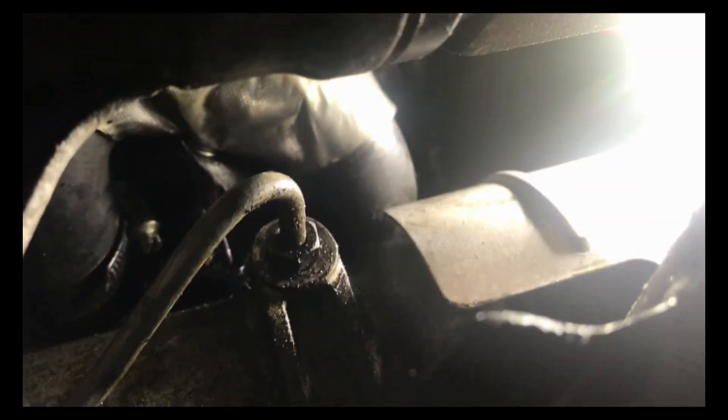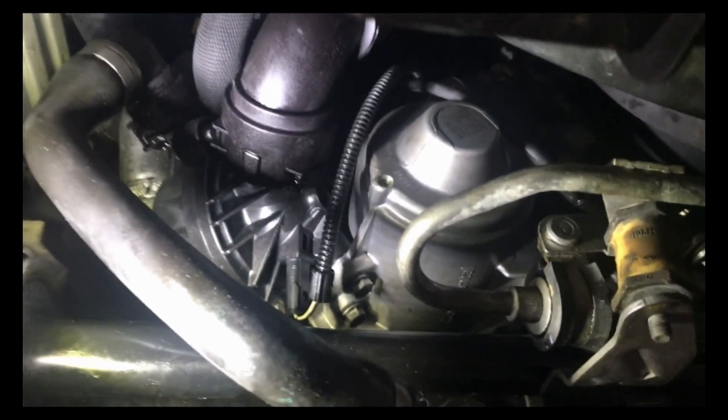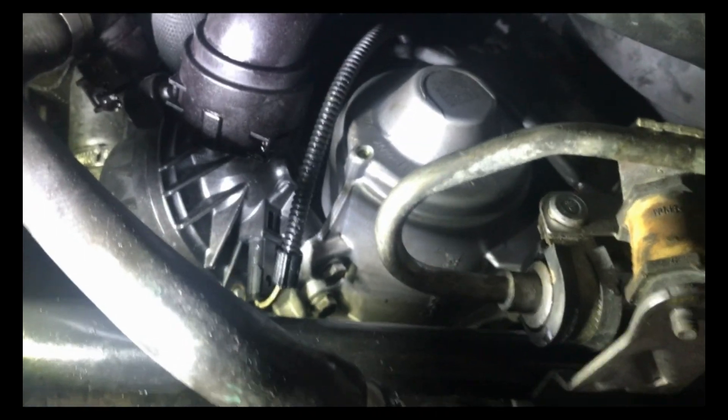I got all the hoses on up front here. In the back there is that U-shaped hose, and in between that U-shaped hose is that other hose that plugs in. All I have to do now is mount the sway bar back up, mount this extra coolant hose, connect this coolant line here, put the shields back on, fill it up with coolant, and it should be done. There's enough room in between the fan and the crossmember — you just have to be sure you have the thermostat loose from the water pump so you can finagle it out.